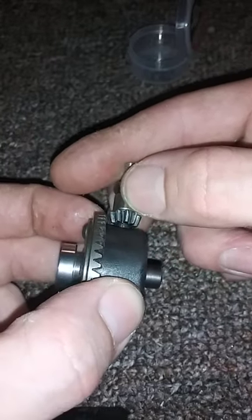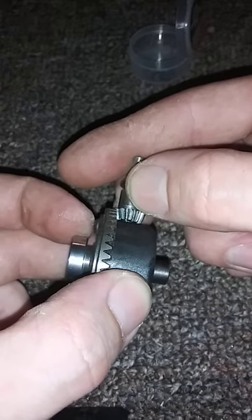So it's pretty much this. You're bringing your ring gear over to your pinion, because your gears are like this from the factory. And when you don't shim, you have all that play. So it just slips right past it and shreds the teeth off the top. So what you're trying to do, come on, focus. What you're trying to do is get this as deep in there as you can. You want the teeth as deep in there as you can,